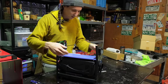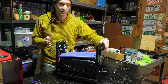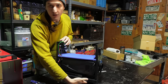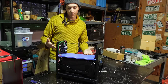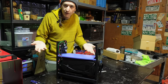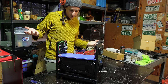The quality is really low. The QC is non-existent. These all-in-one units are interesting. The problem is the controllers aren't waterproof. And I don't think there's ever a situation where you want the all-in-one unit to be inside of your living space, because you have those exhaust connections inside your living space then, and that's dangerous. So I can see where you might want to use these for heating a tent or something, but then if it rains, your heater is going to get ruined. So I don't really understand the point of these, but they've become increasingly popular over the past few years.